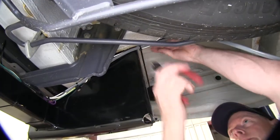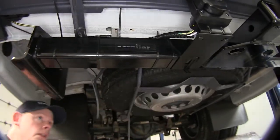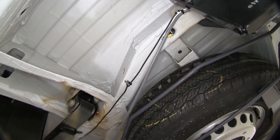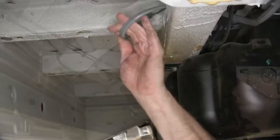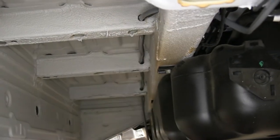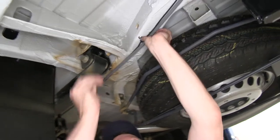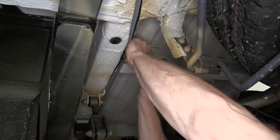At this point we've got our wires bundled up underneath the vehicle by the bumper. We'll cut off the tails from the zip ties. Now we're going to continue running our gray cable up towards the front. Stay away from anything moving like suspension components or anything hot like the exhaust, and run this all the way up to our battery box underneath the front seat of the van. We have some pre-existing wiring to follow, and once routed, we'll secure it with zip ties. It's always a good idea to get extra zip ties for jobs like this.